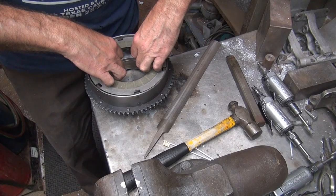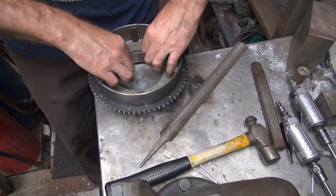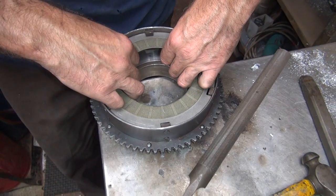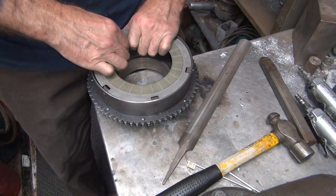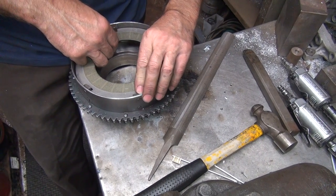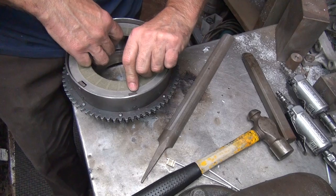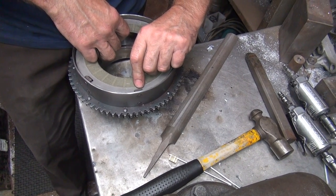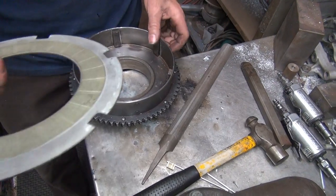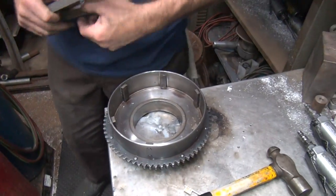You're getting close. When was the last time you had to bang around a clutch basket this much? Last piece of crap I worked on. Yeah, this one just is. Basket case. It's right there. These are really tight fitting plates, the problem. Everything has to be perfect, and this basket's a long ways from that. But we're good up to the very last plate. We're good, see? It's just that last plate. We're going to have to file the last plate. The second from the last, see, it floats all up to right there, and then it starts catching burrs or something. So we'll file the last one. All right, that'll work for that. All right, you can go clean this up. We'll figure out how to put it back together again. There you go.